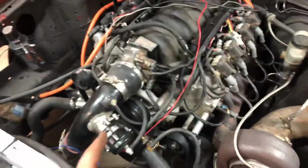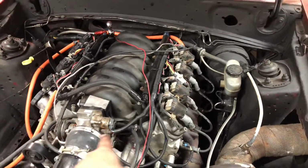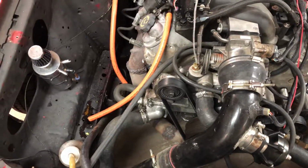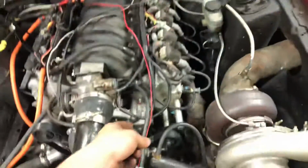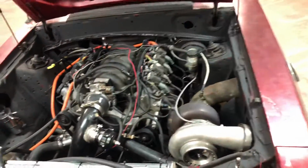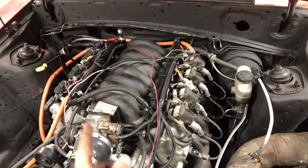Hang on, Christian. The steam ports, I have them running the front two connected to one hose, and that hose is running to the top of the radiator here, which just kind of throws the steam port coolant into the top of the radiator. And then the rear steam ports, I also have a hose coming off of those, and I'm running that one into the water pump. We just have like an 1/8 inch spacer here because we have to run a spacer with this LS1 water pump.